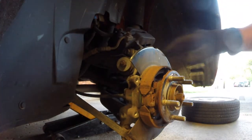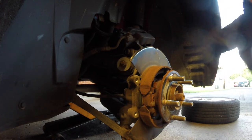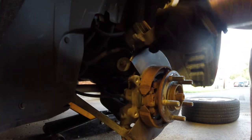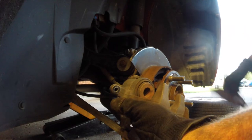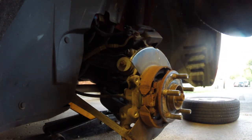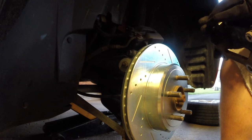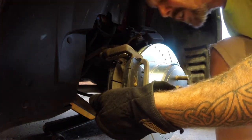Just like my truck, it has a brake shoe style rear emergency brake. Neither one of these rear calipers screw in - both of them are just a push-in style, which really surprised me. That means the emergency brakes must be housed within the rotor, just like on my truck. We'll make sure those are adjusted before I put the new rotors on. I just need to push the piston in, get the rear rotor cleaned up, and get it on the driver's side. Surprisingly, the emergency brake pads did not need adjusting - I did a test fit and had plenty of clearance, so I didn't even worry about taking it back off.